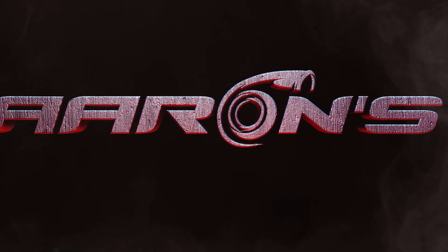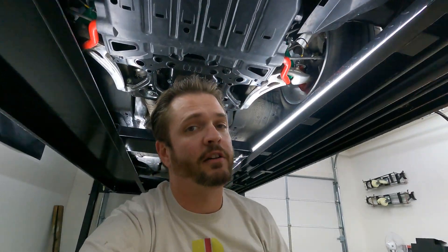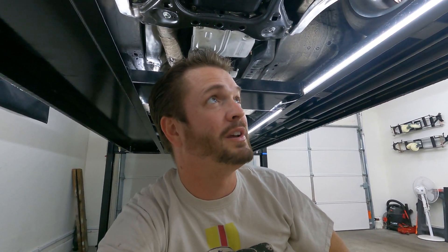Welcome to Aaron's Eccentric Garage. In addition to unplugging the battery, I need to crawl underneath the car to take off the belly pan, the front splitter, and also drain the radiator, take out the air conditioning condenser, and remove the power steering and cooling lines. These are just some of the first steps in order to do this conversion for the RX-8 system into the RX-7 using the JP3 Motorsports kit.